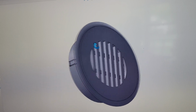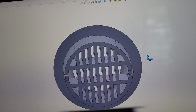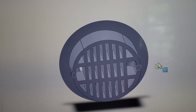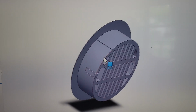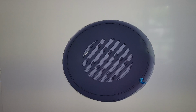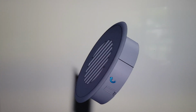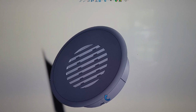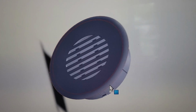So what we're gonna do is we are gonna incorporate a vent that looks like this, and there you go. That is our reinforced vent, and if I modeled it right, it should snap right into place by these little guys right here and have just enough clearance for the fiberglass and the foam pad that we're putting over top of it. So I think that ought to be about perfect, and we're going to use a reinforced plastic that will not melt in the sun. So let's get to it printed, and let me show you what it looks like.